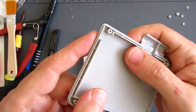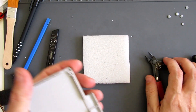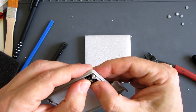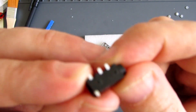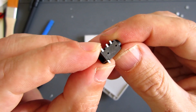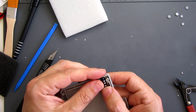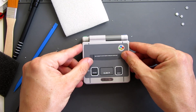That took a while and I really took my time, but I've removed those little bits here - partly with the cutters to nip in here and there, but mostly with the scalpel, very carefully shaving off tiny layers at a time until I had that section removed. The socket now sits flat. It's actually got two tiny little bumps, probably for locating it on mobile phone motherboards, but that's causing about a half to one millimeter raise, so I'm going to cut those off. That's flattened off those two bumps.